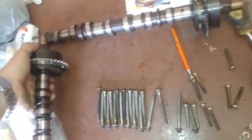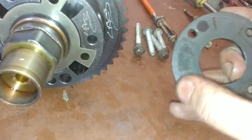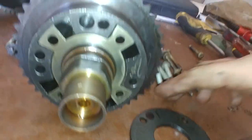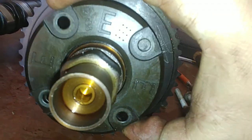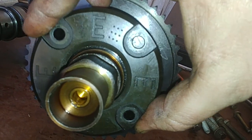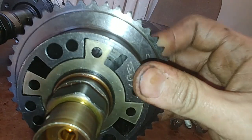Now on to the exhaust. Exhaust is a little bit easier. If you look here, you've got a whole lot of holes — I'm not sure exactly what all of them do, probably for different models. I'm going to use the marking lines on this one to see where it was. You'll have two big holes there, a little bigger than that one, and make sure these fit nicely onto that. Line up the wear marks and check that the correct holes line up — even though holes might line up, they might not be the correct ones. The back plate goes on at the front. On the inside, this one does not have any springs — it's a straightforward gear.